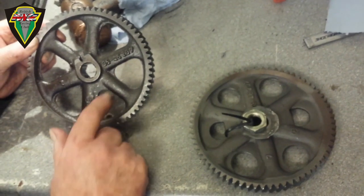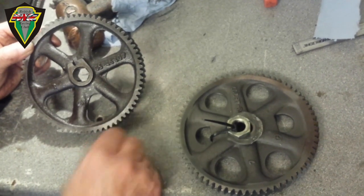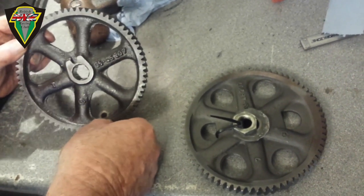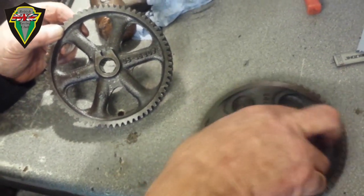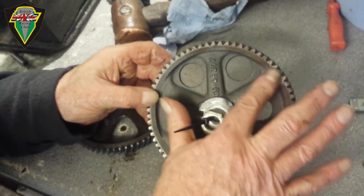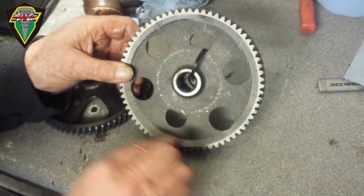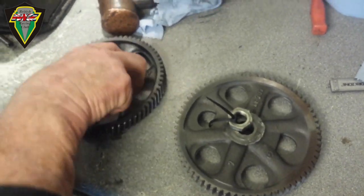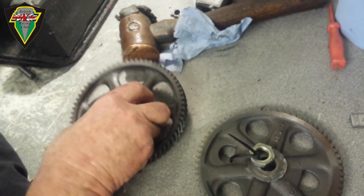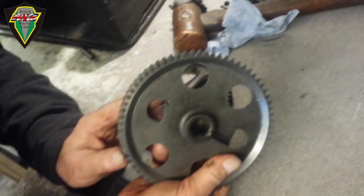With these cast drive wheels they're lightened, but that's about as much as you want to take out of the centre. You can take the corners off here, which is peripheral weight, and is a good idea — and that's actually happened on this one. You can see the 45-degree angle there, which reduces the peripheral weight, which is what you're really looking for. But this one is overall lighter, I'm sure.